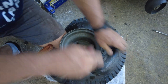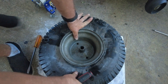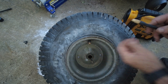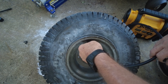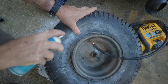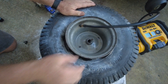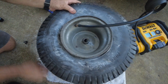I'm getting so close to having this done. The tire is on the rim and now we just have to blow it up. The key to getting the tire to seat on the rim is preparation — I'm going to have my air pump already attached to the tire, turned on and ready to go, so all I have to do is hit the inflate button. The next thing I'll do is spray some starter fluid inside of the tire, light that on fire, and when I do the air will expand and hopefully seat the tire on the rim.